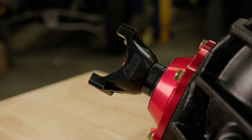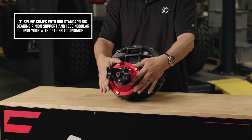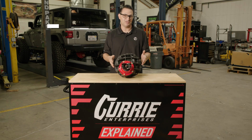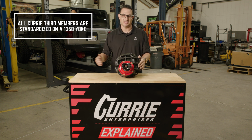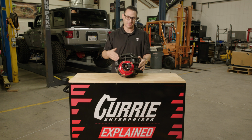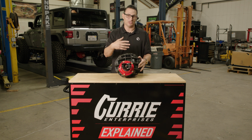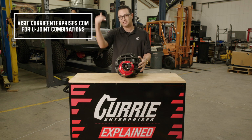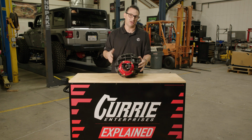In our 31 spline, these are also options that you can option up to. Our standard is going to be our standard big bearing pinion support and a 1350 nodular iron yoke. We standardized on a 1350 yoke. The reason for that is, one, it's pretty much well accepted across the aftermarket. Everybody from a drive shaft company to a driveline company is going to know what a 1350 U-joint is. It's also very adaptable. So if you got a 1310 and you need to upgrade to mate to a 1350, it could be done with a combination U-joint. And we list combination U-joints on the tech page on our website if you have any questions in regards to what those part numbers might be.